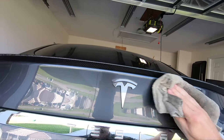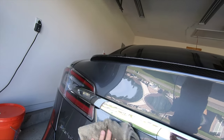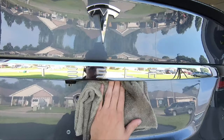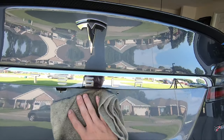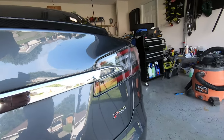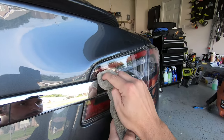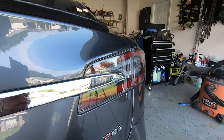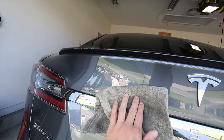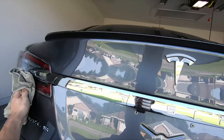We do have to make sure the surface is completely dry, as if it's not, the tape that we're using definitely won't stick. You'll want to focus mainly on the edges and where any two pieces meet. Since this is mainly just rubbing alcohol, it'll dry in a couple minutes, so I'm going to let it sit and then come back and start masking off to get everything ready for Plasti-Dipping.